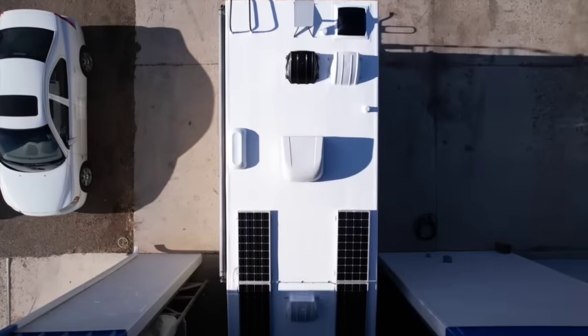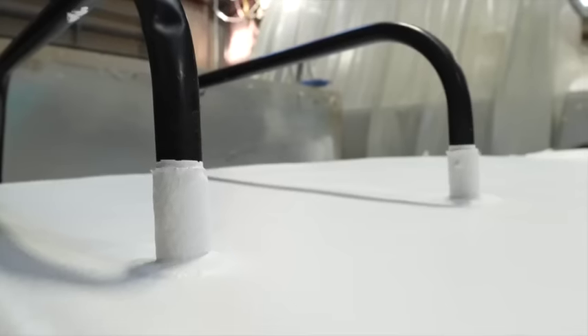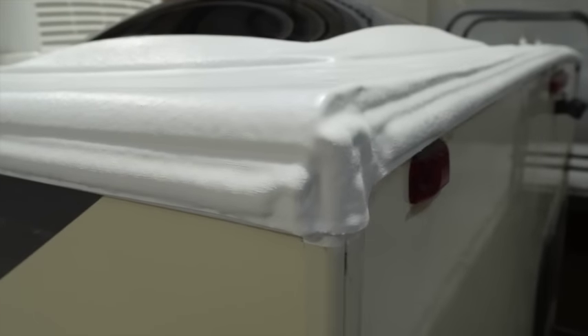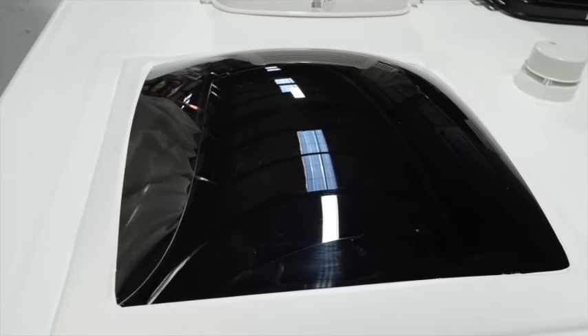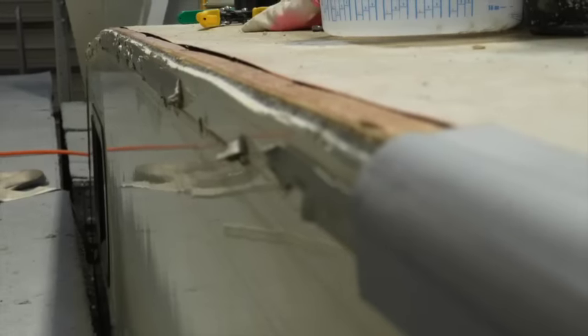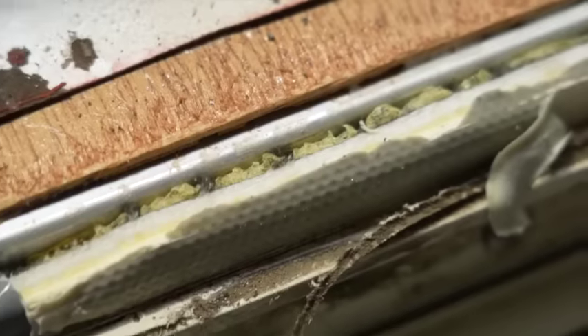It's official — they've finished the roof and I'm ready for the big reveal. They put so much attention and detail into their work here at the shop. Oh wow, it looks so good — holy moly! It's so clean, look at the finishing lines. Her roof looks fantastic. How good that skylight came out — the roof is almost sexier than the rest of the RV. One upgrade I'm super glad we went with is the radius package — they install a rigid steel edge cap. The main thing that does is clean up the line in the transition from the roof to the sidewall and adds an extra layer of protection to the edge of the roof overall.